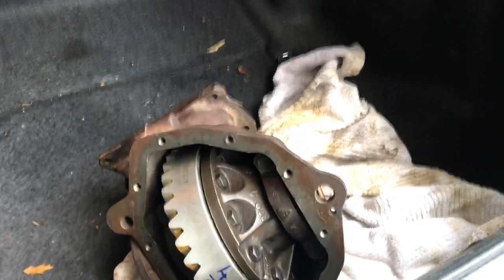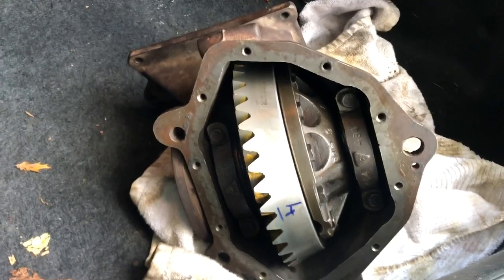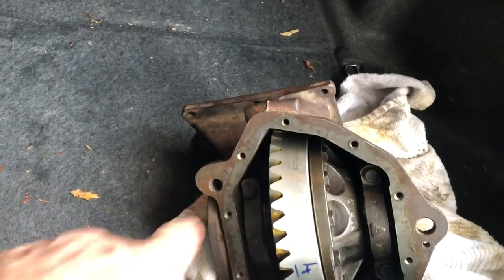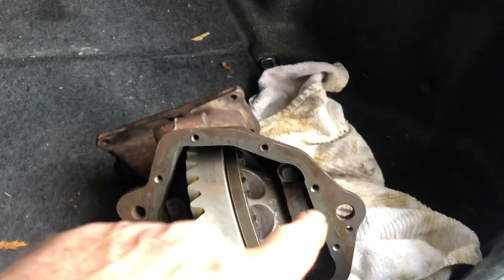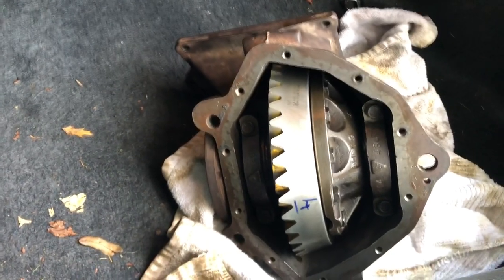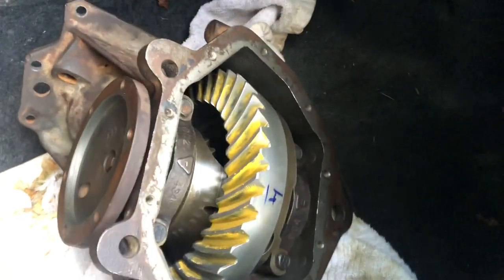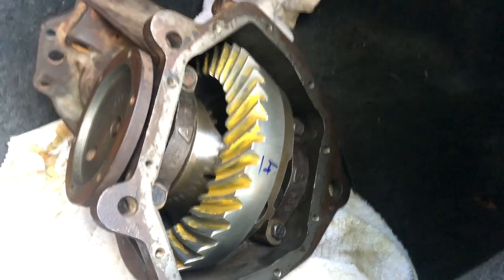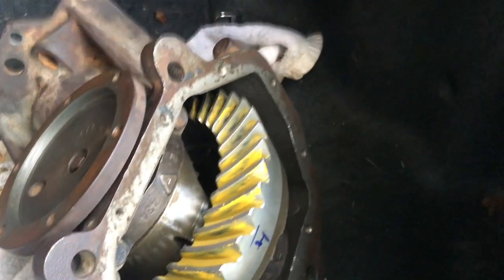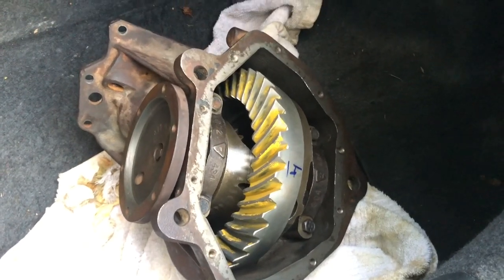All home. Next step is to install it and put our new aluminum cover on there. The pinion I put in the way it came out, using these same existing shims. I removed the one shim from this side and put the smaller of the two shims on that side, and everything ended up setting up perfectly. Now I'm using the original open rear — and maybe with the Posi it's a little trickier — but with this setup the pattern was just right where it needs to be, and the backlash is right where it needs to be. Maybe I just got lucky.